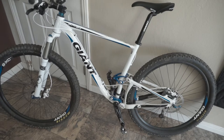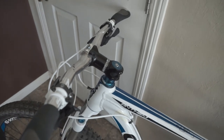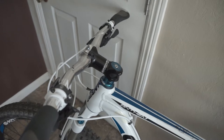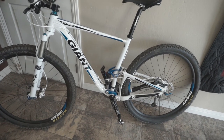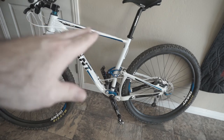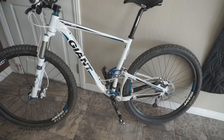Really check the sizing for yourself. When I tried this particular bike, I had a hard time picking up the front wheel — it just didn't pick up as easily as the medium does. What I did was get a shorter stem and wider bars, and it really made a big difference. Bike fit is really important. If a bike is too small for you, it may feel whippy and snappy and move around on you — it's real light under you. You get that small bike and try to adjust it for yourself, but it just doesn't quite fit because you've got the wrong size. It's better to shorten the components — like your stem — rather than be on too small a bike.